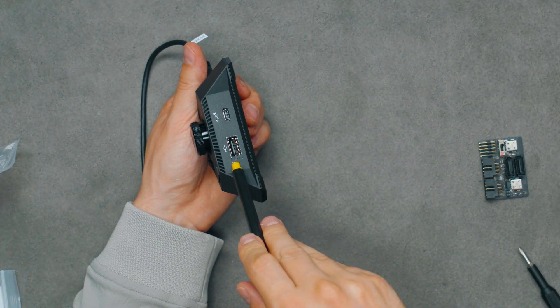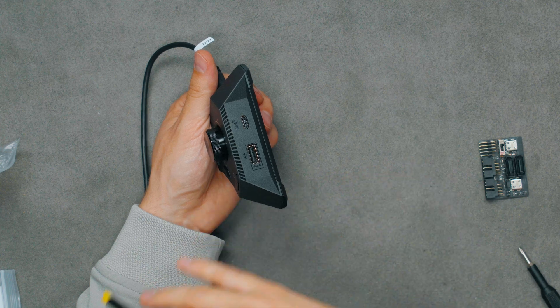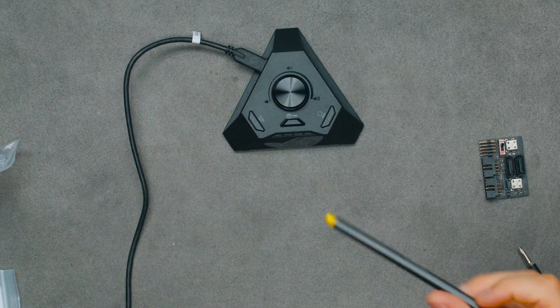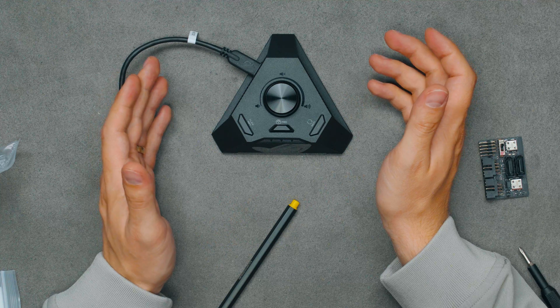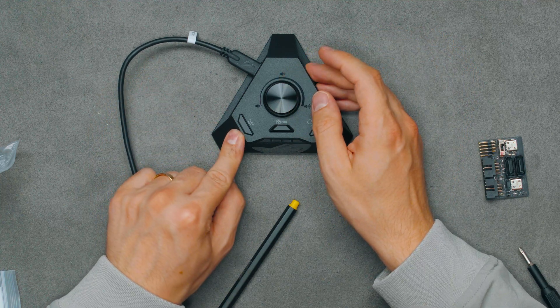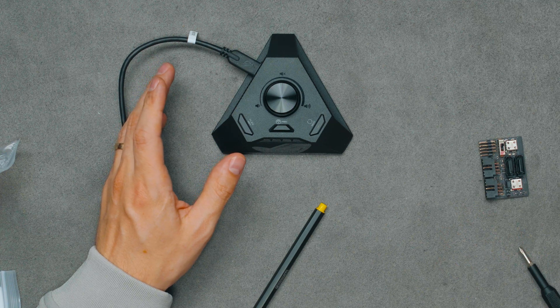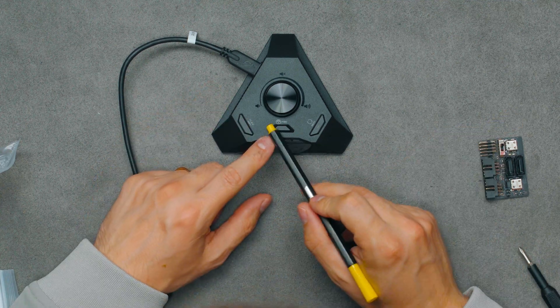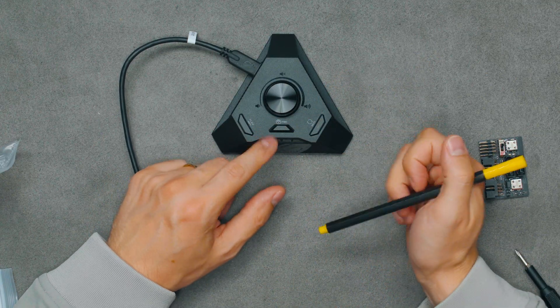On the other side of the hive there's a 10 gigabit USB-C port and a USB 2.0 port, and this one supports BIOS Flashback — you can update the BIOS without a CPU and RAM installed, as long as your PSU is connected. Just plug in the PSU, insert your BIOS file, press this button, and it starts updating. The hive also has a big knob for volume control, pressing it mutes or unmutes. The Flex Key on the left is a system reset button — very useful in SFX cases that often only have a power button.